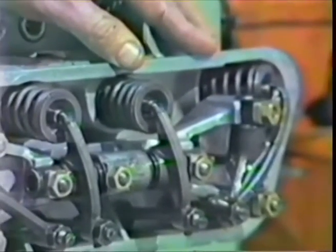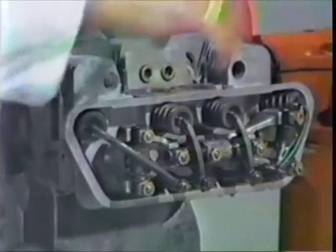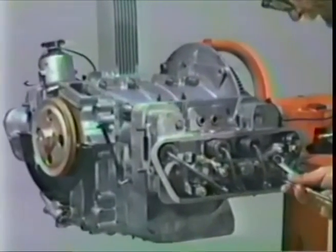Now what we do is with a 13mm wrench and a decent screwdriver, we go over here, wiggle the valves. One has a lot of gap, one has almost none. So we first start on the exhaust, loosen it up to where we have some gap. And then you can use one of 3 techniques here: the imprisoned feeler gauge method, with a feeler gauge imprisoned here; memorize slot location, where you memorize the position of the slot here as you adjust it; or the calibrated arm. And for an initial valve adjustment, I'll show you the calibrated arm technique.